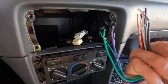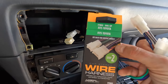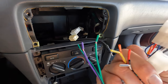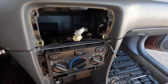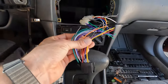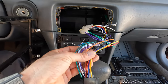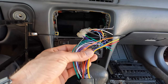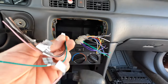Here's the wiring harness I got — AutoZone has it, I'll put the Amazon link and all that in the description. I'm going to plug these up and then splice the radio's wiring harness into this one. The easiest way to tackle it is to first do a color match: solid purple to solid purple, purple with black stripe, green with black stripe, solid green — just do that and tie them all together.